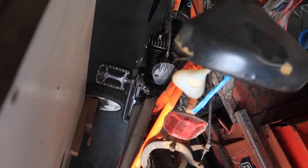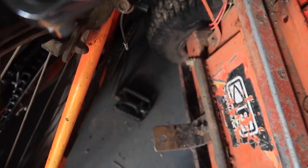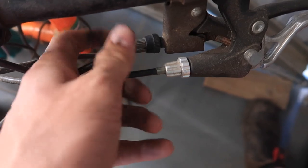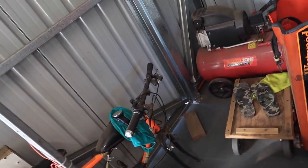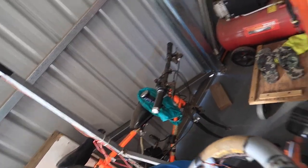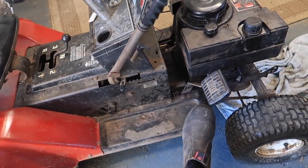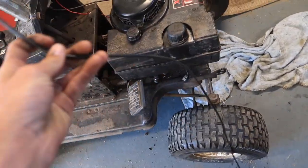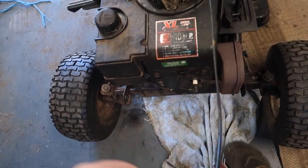I'm going to steal the brake cables off my motorbike because the back brakes don't work really anyway. It's got all the little attachments and everything, so I pulled that off — should be long enough to wrap under there. I robbed the cable off a bike. This cable is just long enough by a couple of inches; it goes under the engine past the exhaust, which is definitely going to be changed anyway.